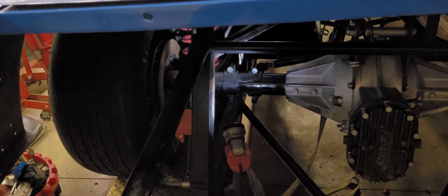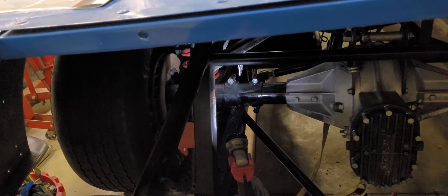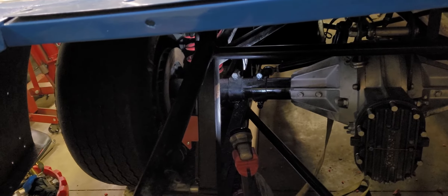I've moved on to the rear suspension. Just to remind you guys, the reason why I'm doing this is this car was originally a coilover suspension car. For the class I'm going to run with it, it has to be a 5-inch coil spring car. You can run coilover eliminators, but it really becomes a packaging issue. You won't have the screw jacks with a coilover eliminator.